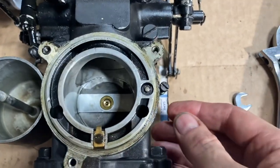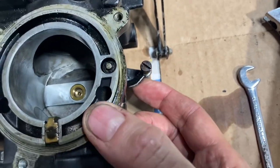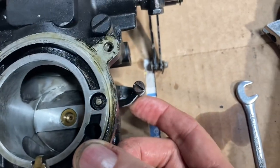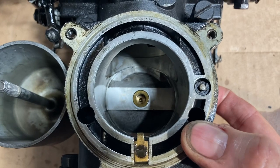This is a view from the top. When I move this lever here you can see the main jet moves down, so as I screw in this set screw it pulls the main jet down, which richens the mixture.